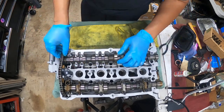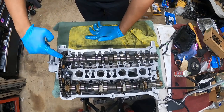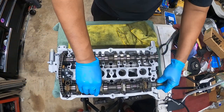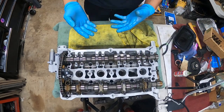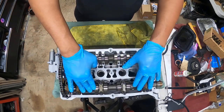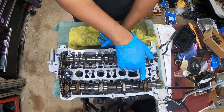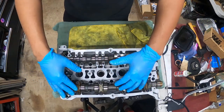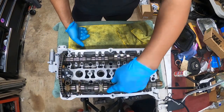What matters there? So we're set now. Again, this is the procedure. You'll see now this notch is lined up with this one, and this one is off to the left. That's how you know you got it right. It's a little finicky because you're working with a really tight space. When this cam is locked down, you can, if you want to, unbolt half of the caps or even almost 90. It'll give you a little bit of slack, but don't remove the cam, okay? This cam cannot come off. This has to stay on.